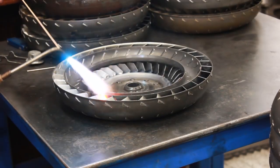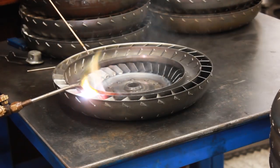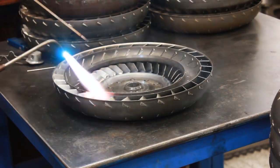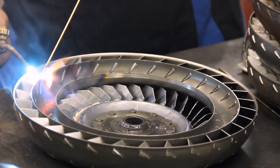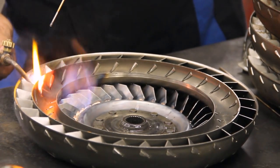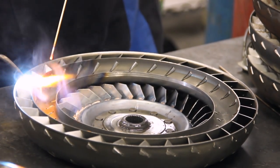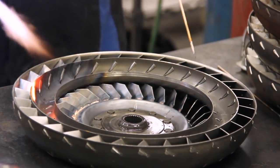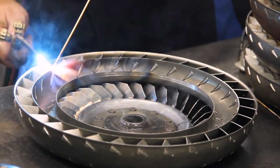You can see that blueish, greenish flame — different converters, depending on maybe the oil or what's in the oil, on some converters you get different colors. You know how quick we do this? Keep it going in a circular motion, walk it right down. The silicon bronze is amazing stuff — no flux required. You can just follow it right down and it really tightens all them blades up. They've got no chance of moving after you braze them. I'll braze actually the inside and the outside.